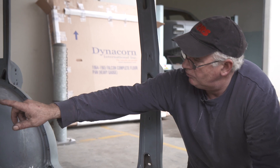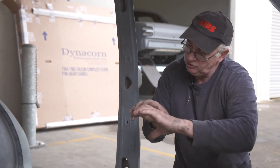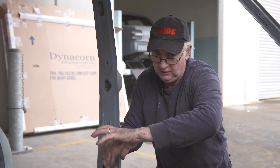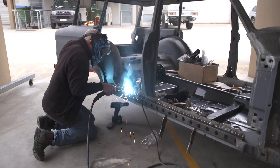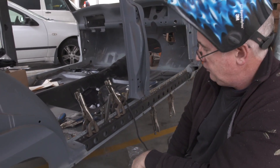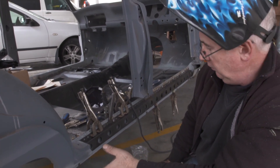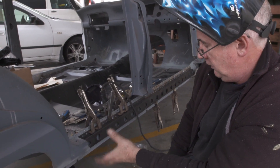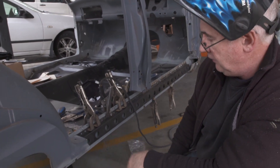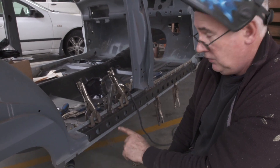Added to that, there's either a Watts linkage or a Mumford linkage frame put in there, which ties the two frame rails together. Those two things make the frame rails act as one, which cuts out torsioning and beaming to a certain extent. What we're doing here is reinforcing the chassis in the neatest, simplest possible manner. When you increase the folds, the gauge of the metal, and strategically put in body stiffening, you've got to think very carefully about how it affects the monocoque chassis. There are a lot of gimmicks out there — this works.